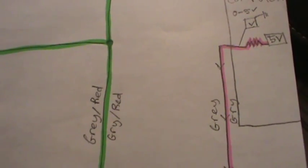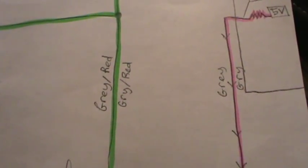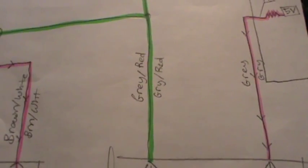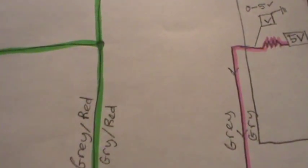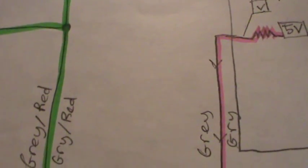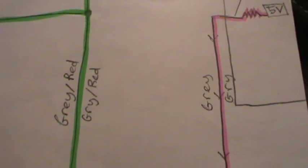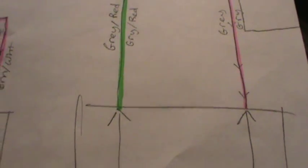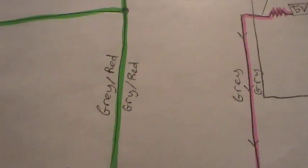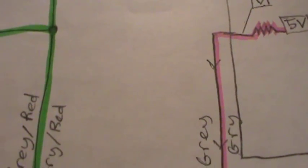So what you're going to say is: if you unplug it and you see five volts at the connector, you know you have a good five-volt reference at that connector. But if you notice, you cannot see any part of this outside of the computer — but that's what's happening inside of the computer. So that's what you need: you need a ground, which is over here, and then you also need that five-volt reference.